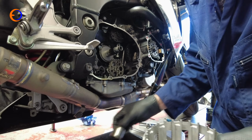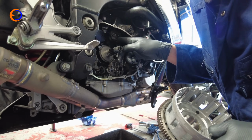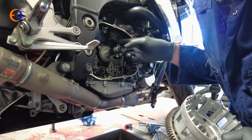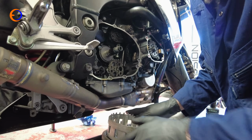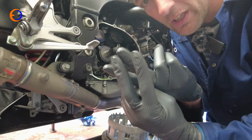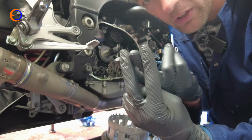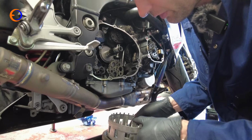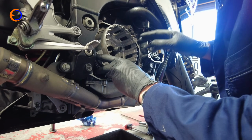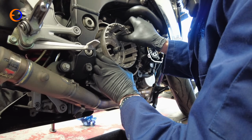And then when I put the basket in, I have to line it up with the gear in here, because the gear for the generator drive has a silencing gear in it, so you've got teeth like that, and then the silencing gear teeth sit slightly offset from them and spring load against them, so the 2 gears don't rattle against each other like that. So when you put this in, you have to slide it in and then push it upwards to engage into the gear as you put the bearings in.